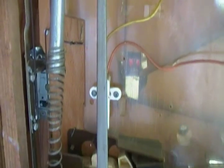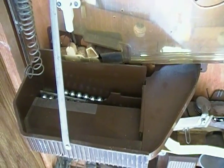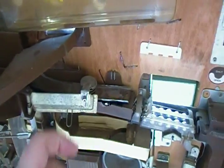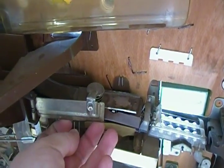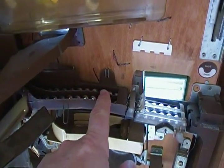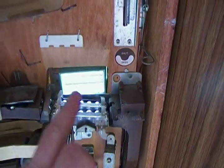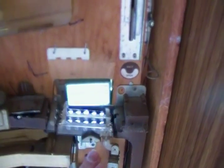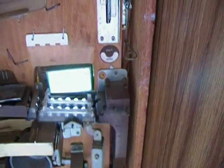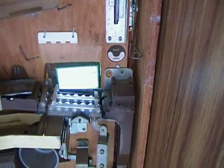The balls travel down the tube and down into the jackpot tray. As you can see right here, there's some in there. This doesn't hold a whole lot of balls in its current state, but it will fill up. The balls travel along underneath here, go underneath the tray. This cover right here keeps the balls only one row thick until they travel over here to the jackpot seesaw. There's usually a cover over the top, but that's the reason I chose this machine — so you can see how it will work with the cover missing.